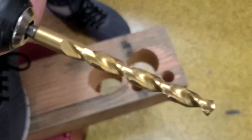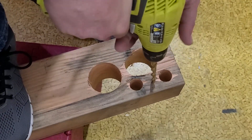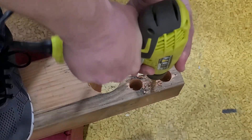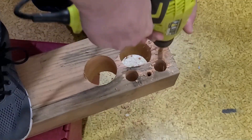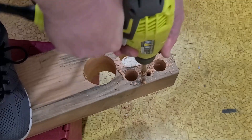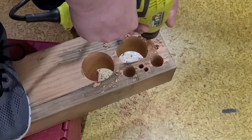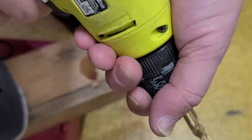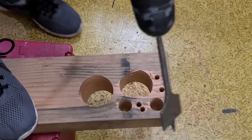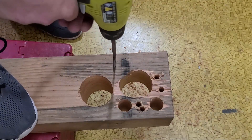We'll knock — I guess this is a 3/8 drill. We can see at least the spindle and chuck do run true. Only 1600 RPM but five and a half amps, tons of power. Really being a planetary gearbox, it does sound pretty nice under load. We have a half-dull inch and a half spade bit — let's see how it does with a little bit more load on it.